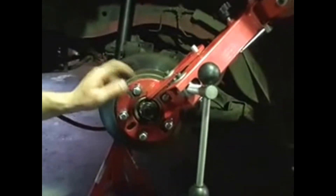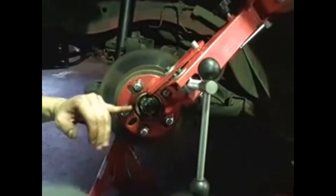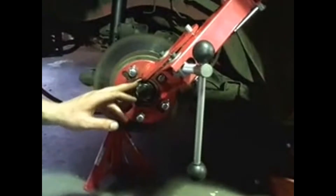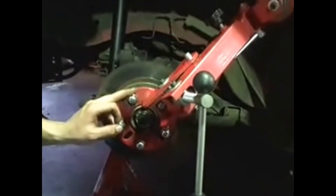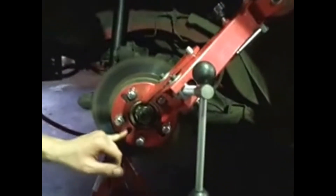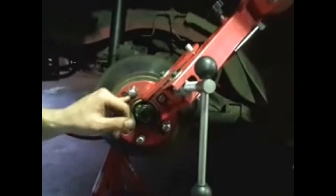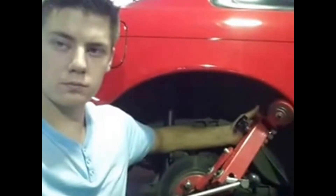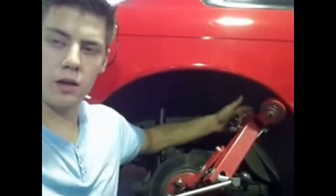The way this device bolts onto the wheel, you actually just use your wheel nuts or bolts. You want to take your wheel off, keep your nuts, and this fits right on. It fits on multiple PCDs - my wheel is five by 114.3 and as you can see it's got all these adapter holes, so this thing just bolts up real nice.